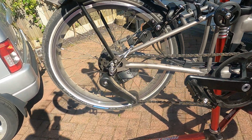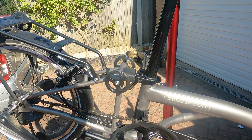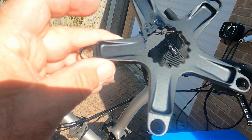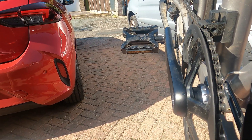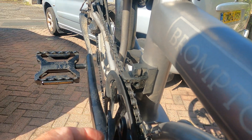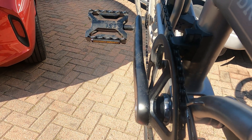Especially in London it's superb, and places like Kings Lynn where it's fairly flat it's easy going too. The bike also needs a good clean. I want to experiment and change the gearing. I've got this carbon Cannondale spider thing to fit, but the offset - the distance from here to where the chain ring fits - isn't enough. The chain ring is going to be out five or ten mil too far, and that's too extreme for the chain line.